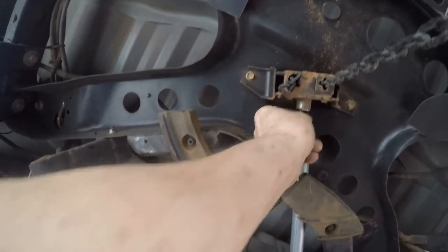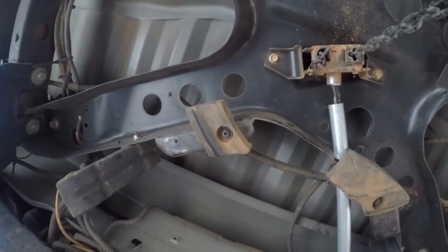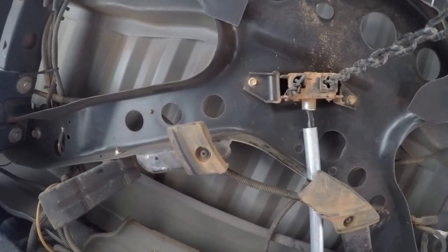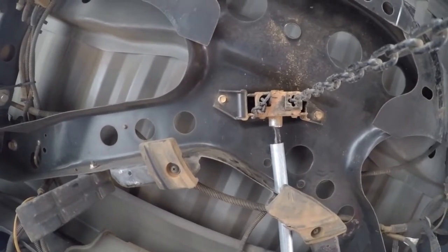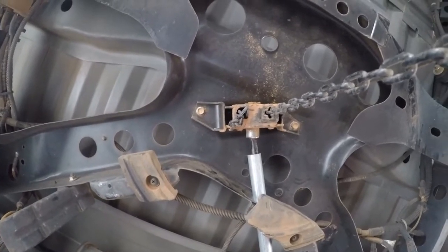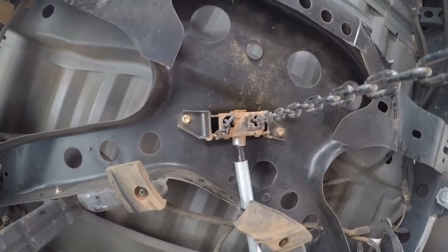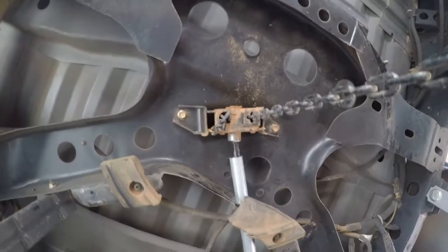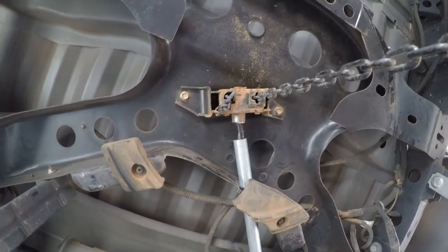There's our jack. There's a little piece that fits in there. And that'll line up perfectly and you will never have another problem in your whole life. What I have been doing with my travelling is having the tyre in the back of the car, which is ridiculous because it takes up so much room. So when I'm towing with the caravan, always make sure you've got a kangaroo jack with you so you can take the weight up a little bit so you can drop the tyre, because, would you believe, if you've got a flat tyre on one side, there would not be enough room to lower the tyre down to the ground and drag it out underneath the car.